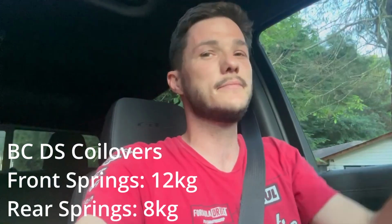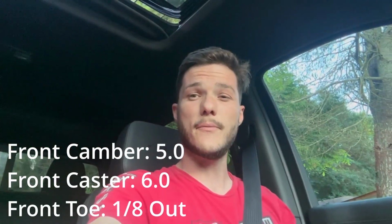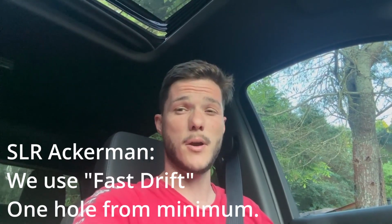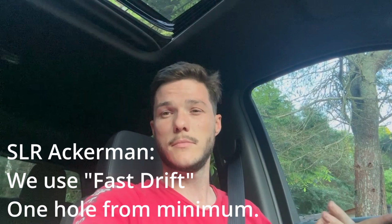If you guys want your car to snap like that, just follow that science right there. Digressive valving, some stiff springs up front, loose ones in the rear, front sway bar, no rear sway bar. Then camber settings we talked about, raise it up in the front. It's great. It was great. I appreciate you guys.